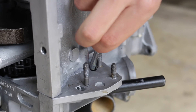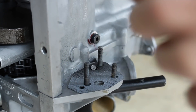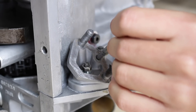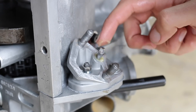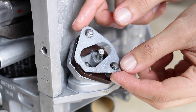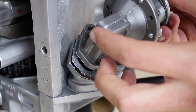The mechanical fuel pump for Alfa 105 series engines is powered by two little push rods that are themselves moved by a cam on the oil pump. There are a whole bunch of little gaskets, fittings, and spacers that have to go on before the pump itself can be installed. I put quite a bit of grease into the pump itself to try and extend the life of this mechanical unit.